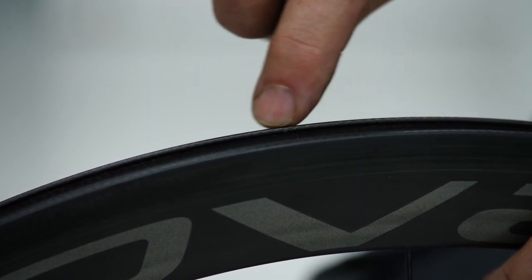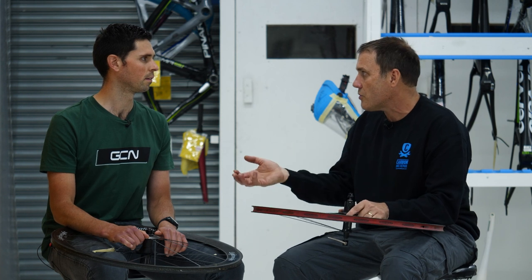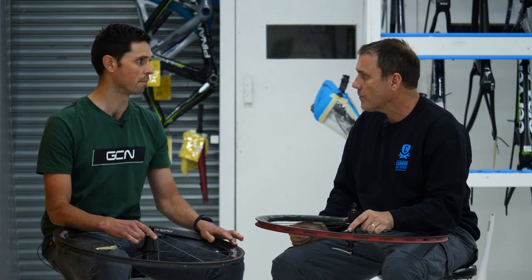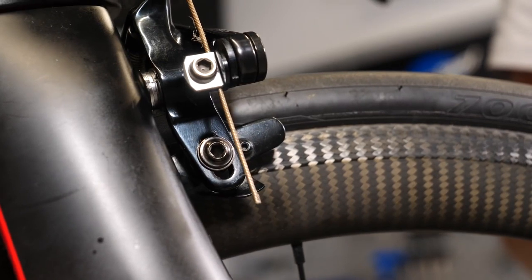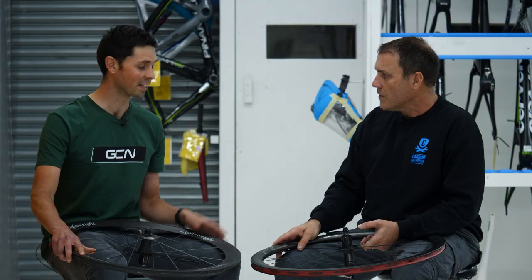So you really want to be looking out for spoke pull-throughs or any damage going into the clincher wall — that's a no-no. Also watch out for constant blistering or brake pads colored and embedded into the surface. You can try rubbing it with a Brillo pad, but it won't come out because it's actually melted into the resin — which means it's delaminated and the structural integrity of that braking surface is potentially compromised. There's a great advantage to carbon wheels in their lightness, but some things you've got to look out for — safety first. If you're not sure, take it to a carbon repairer.